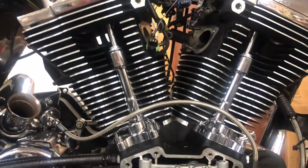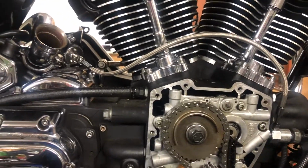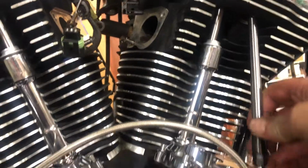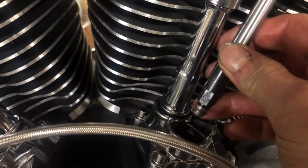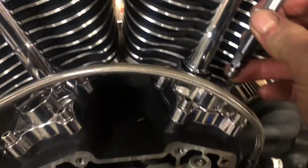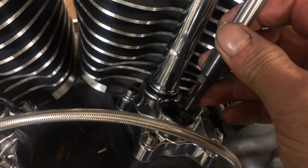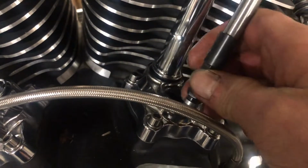Okay, that's my inlet's done. Now, just to let you see these push rods, where these went, you stick them in and they collapse all the way down, so you can clear the tappet block. And they drop down into place, you just screw them out and then go down it against the follower. So that's where these things went over the standards.